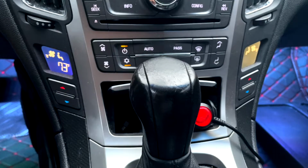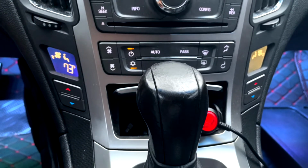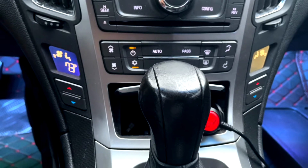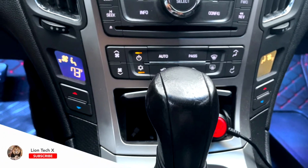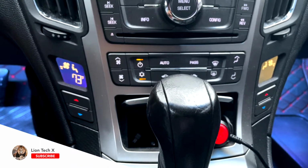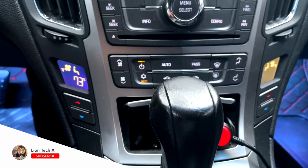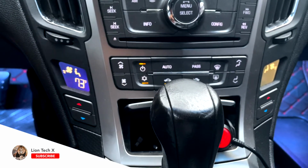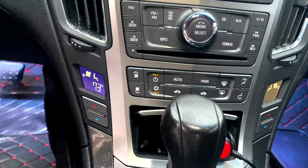Hey, I just wanted to tell you real quick, guys, that with certain vehicles you might have to do some extra programming. I know with my car I have to hold down both of my front window buttons down and then hold them back up, so that it programs the automatic down and up with the windows. Some vehicles may be different, but you might want to look into that after you connect your battery and turn on your vehicle. And this is for all electronic devices, right?